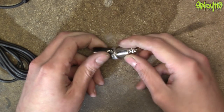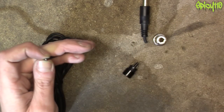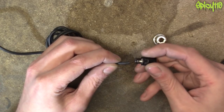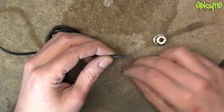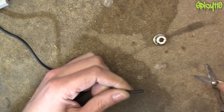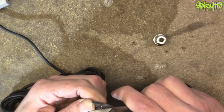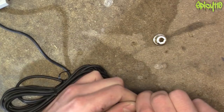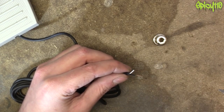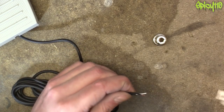In theory it should just be a case of cut the cable and put it together. I'm using scissors to strip wire — I don't actually have wire strippers because I've never really needed them. I've always used scissors or a knife. Yes, I know you end up nicking the cables if you're not careful. The voltage shouldn't be an issue anyway because this is probably a solenoid switch — it's barely taking any current. It's switching the switch which switches the switch that handles the large current.